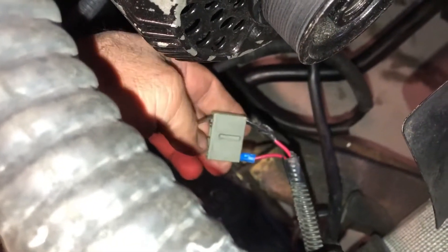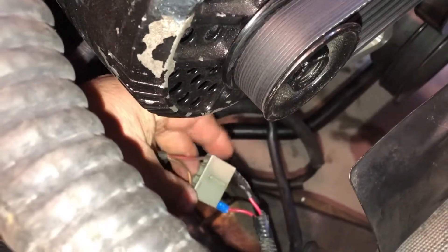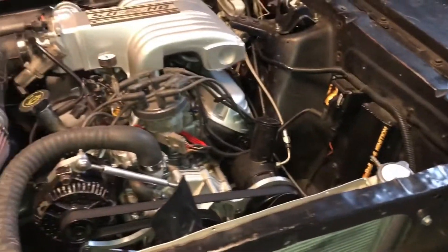Here's the finished product. I went with two spade connectors, and the green-yellow wire goes to the white wire on the far left, and then the red wire goes to the red wire. I ran them to the radiator support and I'm gonna tuck them into that loom. I'm thinking I might go ahead and get rid of this connector altogether, splice these together, and run them in a wiring loom and zip-tie everything up. So I've got some cleanup work to do. Fire it right up — sounds pretty good.